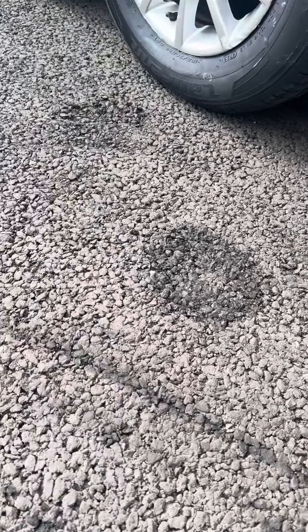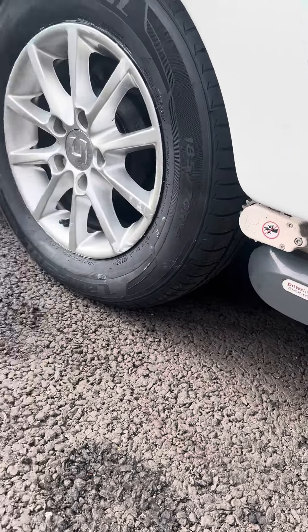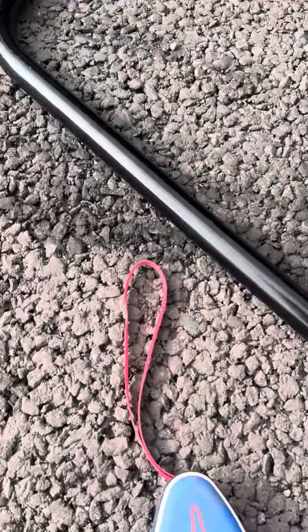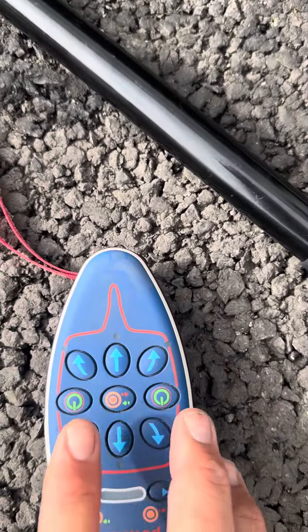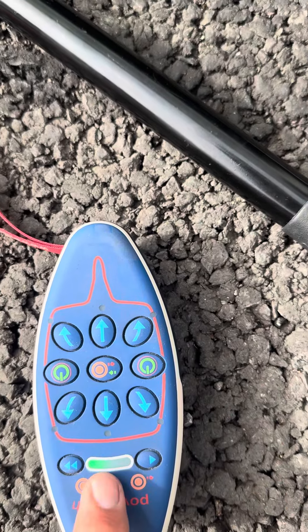Go to the motor mover and put the motors on the wheels on either side. Once you've done that, take the handbrake off, then use the handset — simply press the two on-buttons and you'll see the green light come on.